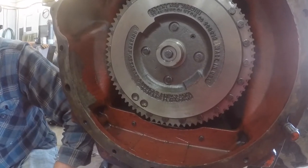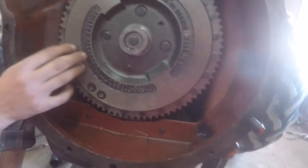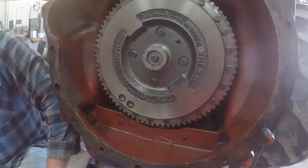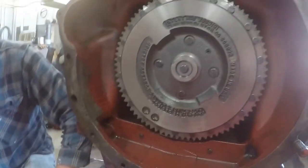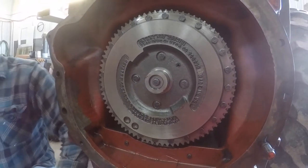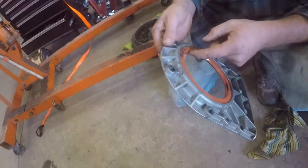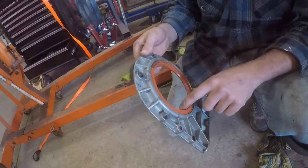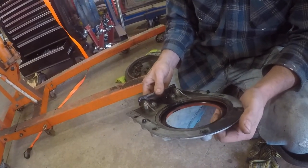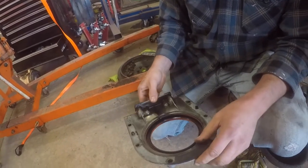It's not like a drum for a clutch or a servo — it's not like this part moves at all. Nothing moves. All the actuating stuff is behind this plate. I'm glad it's like this so we didn't have to pull that case-o-matic apart. Now, the other major thing with this whole setup is if your rear main seal leaks, you are contaminating the fluid for the case-o-matic — it's going to dump motor oil in the case-o-matic housing. You want to make sure you change your seal and put a nice one in there. This seal looks pretty good — it's not even hard.